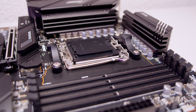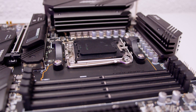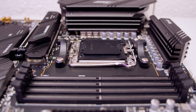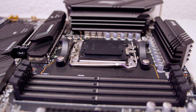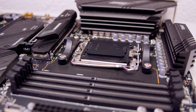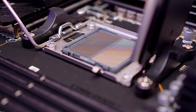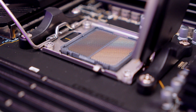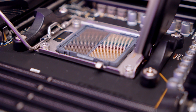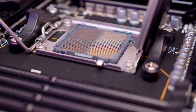One thing we've talked about at length with these AM5 boards is their cooler compatibility with AM4 coolers. We've got a full guide on what will and will not fit with AM5 cross-gen compatibility — I'll link that in the description. As you can see, it uses standard AM5 cooler mounting with pre-installed mounting hardware. If we open up the AM5 socket, which is actually LGA1718, you can see the contact pins for the back of your CPU. Be careful, because if you bend something here, your CPU is not going to work.